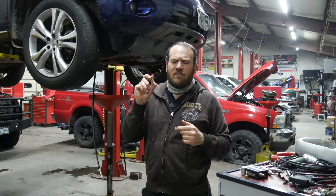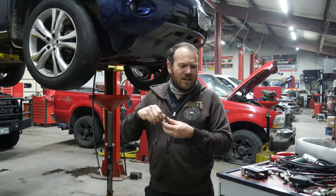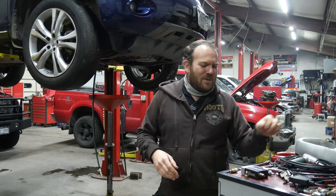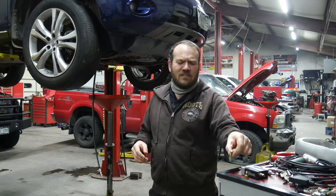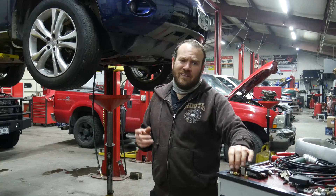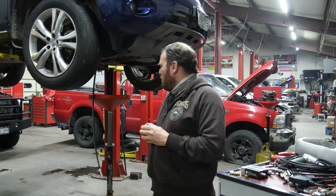Since it's a quick disconnect setup and all my adapters have those same fittings, it's very modular and I can interchange very quickly. These seals do wear out in the quick disconnect couplings after a while, especially when used on the fuel system. Right now I'm down to my last bits and pieces, so I'm going to have to order more — they're not the cheapest things, but they're handy. I don't know if you can buy a rebuild kit, but if I can, that's the route I'll go.